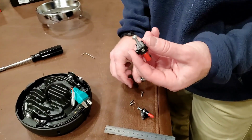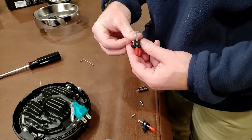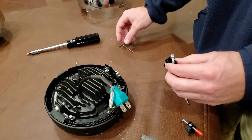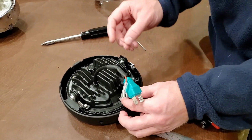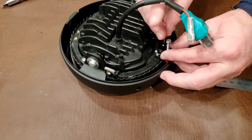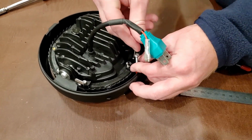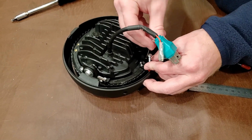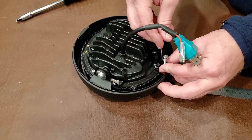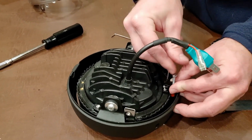All right, so taking the hardware you just constructed, we're going to take M3 screws, and using an M3 Allen wrench, we're going to put those on. Now both adjustments are exactly the same. For a level adjustment, we're going to probably be around 5 to 7 millimeters of screw height, and I'll show you how to actually judge that.